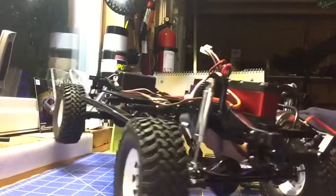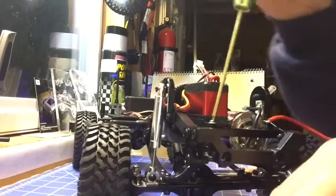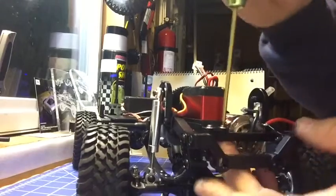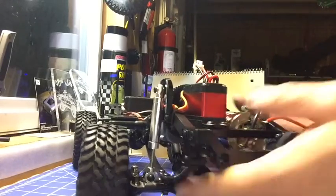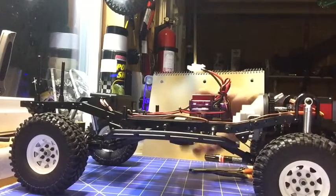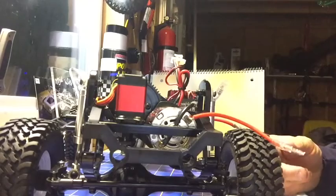I think I had mentioned I'm going to have this apart again soon because of some upgrades and tweaks I want to do. I have shooter shackles to add, I have the RC four-wheel drive Punisher shafts, because the out-of-the-box plastic ones will last you about 15 seconds and then pop. That's probably the most disappointing part of this truck — that RC four-wheel drive put something so flimsy on it after you pay through the nose for the kit or the truck. I have another video on my YouTube channel, it's a real short one — it shows my blue truck about 30-40 seconds in and you see something fly out the side, and it's the drive shaft.